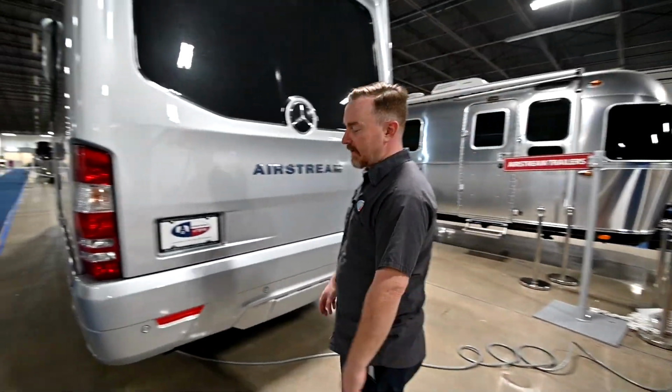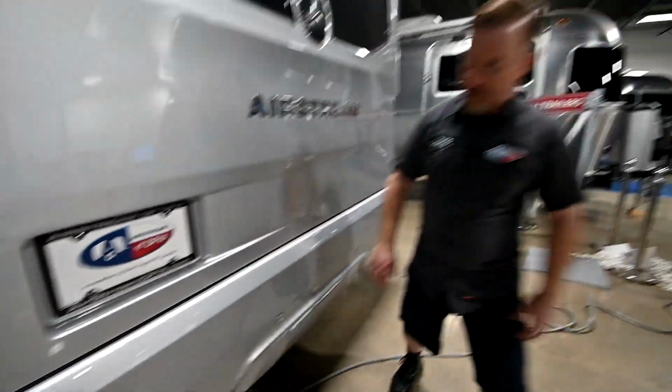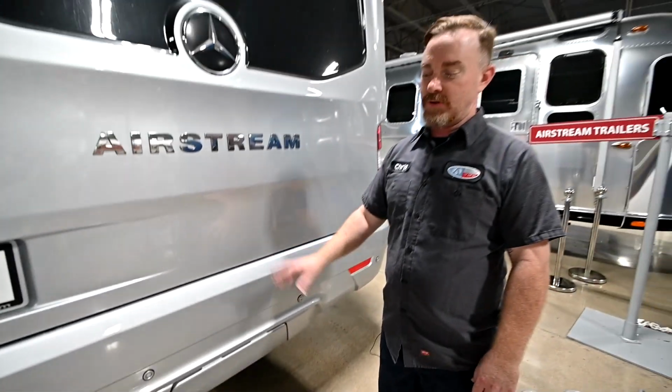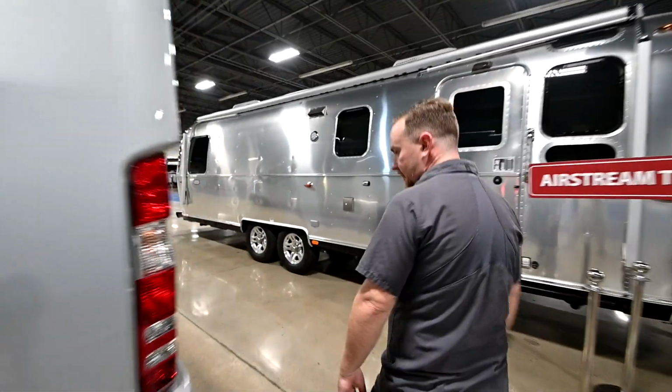And any of that waste will be trapped in that chemically treated water and it will exit the next time and your toilet will be ready for use. So at that point, you would only need to add a little water to the bowl and go ahead and do your business. Once you're finished with the black tank, come outside and do the gray tank second.